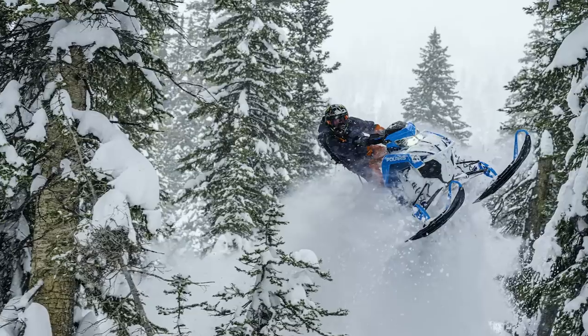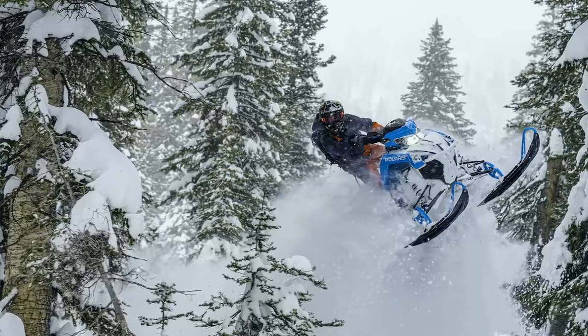To maintain the durability of the track, you've got to do two simple things when riding it. The first is scratchers down on the trail. For 2024, we've got new reversible scratchers standard on all of our RMKs. They're a single coil reversible design so you can back over them — way more durability — and they throw way more snow into the skid. That delivers better track cooling, which is key for 325 durability, and better engine cooling to keep your engine temps in check on the trail. The second is keeping it under 50 miles an hour on the trail. For 325 sleds, there will be a 50 mph speed warning on both the Message Center and 7S display, letting you know you're going too fast and putting the durability of the track at risk.